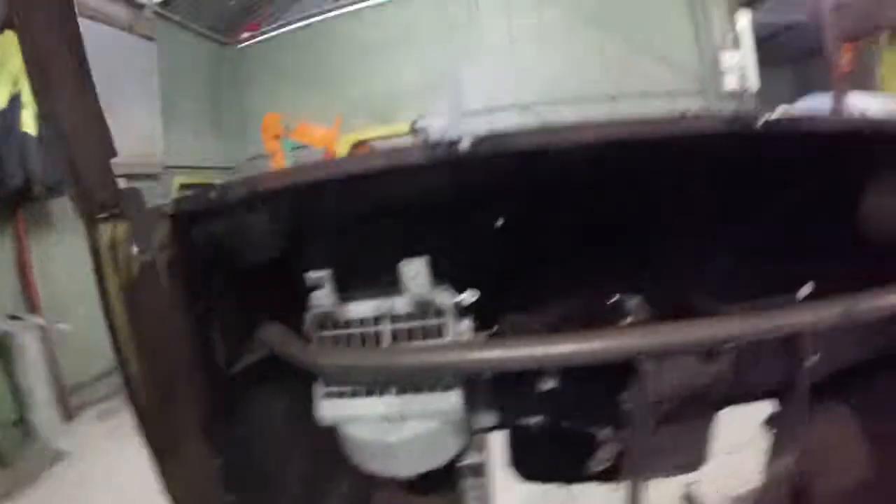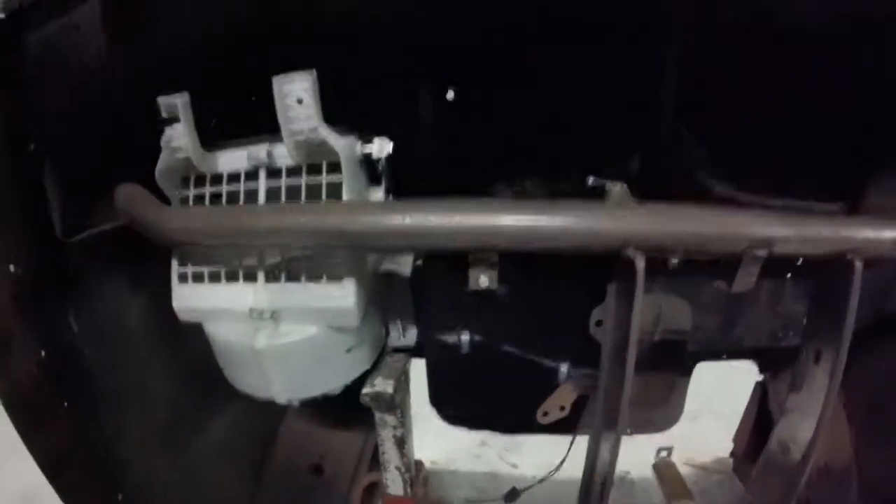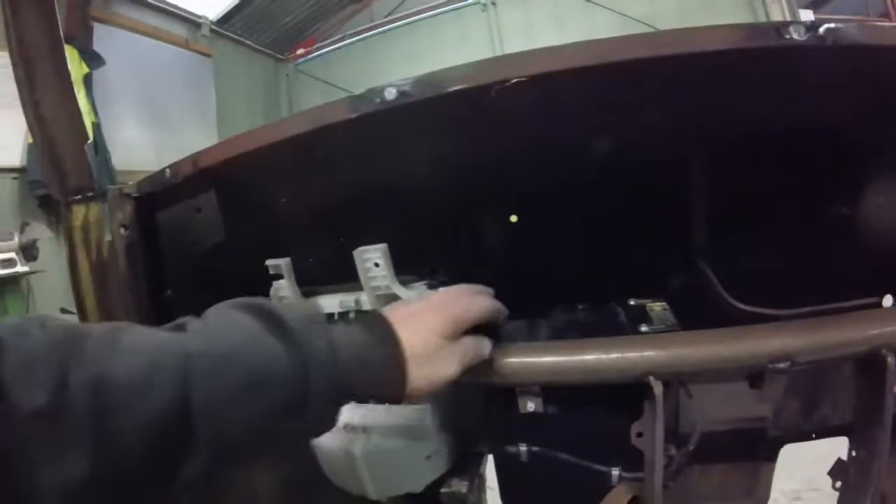These are our first two components — fan motor and heater core. Actually it could be the aircon. Right here where my hand is, if you can see that — that's the outlet for the AC. They're about maybe past the actual back of the box; they're probably about two and a half to three inches long. So this whole unit can go back two and a half to three inches. I've left this out a little bit from here because as it gets pushed back, it's going to need to come over a bit with the cowl being tapered.